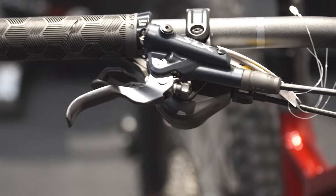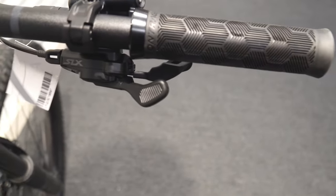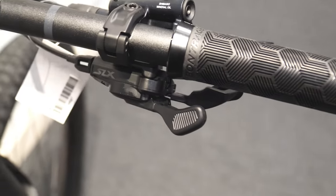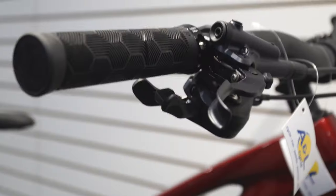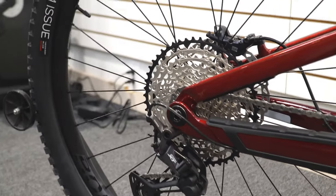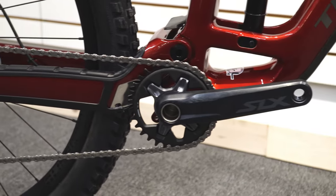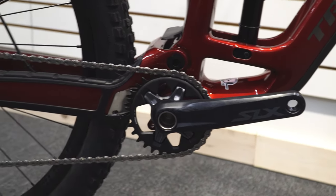The handlebar is fully customizable — a really nice touch and very well performing. Looking at shifting, you've got the SLX shifter, which offers some texture. It is just plastic with no rubber gripper, but it still feels good, and you can use the front shifter paddle to push or pull. At the back there's an XT derailleur and cassette with an SLX chain, giving good performance and durability, connecting to a 32-ring on the front via an SLX branded crank.